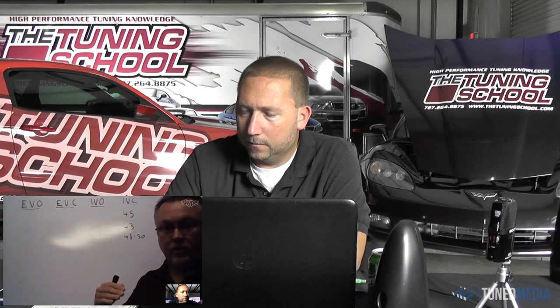And it all depends on what your goals are. But we all see positive displacement supercharged cams that make a ton of torque, but they don't make as much horsepower as they do torque. Right. Well, those guys are not going to be happy with that. No. If their car makes 800 foot-pounds of torque, they want it to make 800 horsepower also. That's true. They're trying to get that top end back. Exactly. Whereas a centrifugal guy may be the opposite, and he obviously needs help getting that thing moving. That makes sense. And the other events obviously play into that. They're not as critical, I take it?